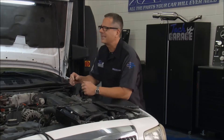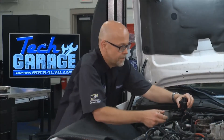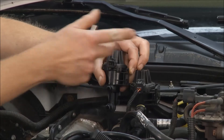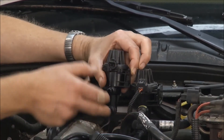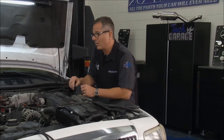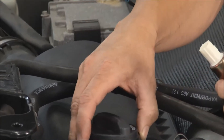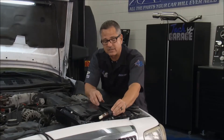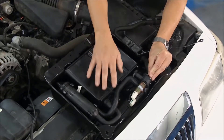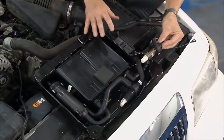This whole system is pretty cool because we can get the separate components at RockAuto, or we can get the whole thing. Here's an actual purge solenoid, which is located up here. What does that do? You've got fuel vapors coming up from the tank — they're going to be sucked through the manifold, burned up in the engine, and then when the car is off, vapors might come back out. This controls the flow of fuel vapors in and out of the manifolds so they don't get released into the air. That's an electrical component that also has mechanical hookups to it, so that could be a problem. You could also have a vent solenoid, or the gas cap could go bad — a lot of times they leak. Here's the actual vent solenoid, located right here in the whole unit under the car. When we smoked it, we tipped this unit down and you can see the smoke pouring out from one of the hoses right there.